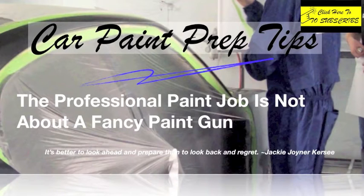Now, if you prep that car and you did a really good job, and then someone really talented sprayed it, it's going to be a different story. It's going to look awesome. So anyway, I just want to stress that a little bit. Cleaning is so important. You're going to clean it before you start working and sanding. You're going to wash it before you paint it, after all the sanding has been done. So prepping is a lot of washing. I wanted to point that out because this is often overlooked. You do not want to skip that step.